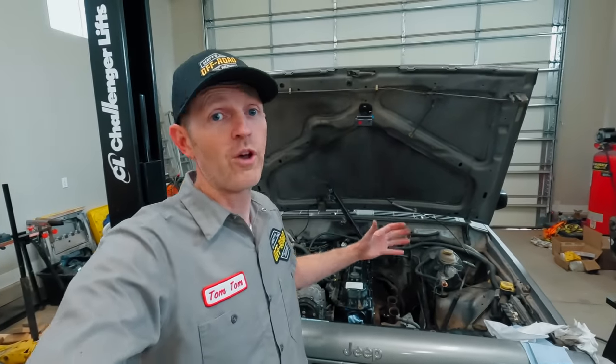I feel like things are going really good here. We've got the installation on the run. I did create a little problem for myself when I took the exhaust manifolds out. The bolts were so rusted that I did some grinding and hacking with a zip disc and I cut right into one of the exhaust pipes. So I've got to weld that back together before I stick my exhaust manifold back in. I'm gonna do that now.